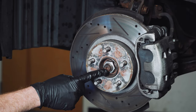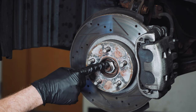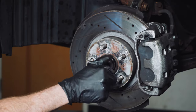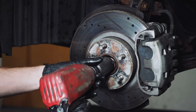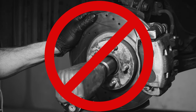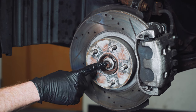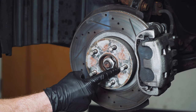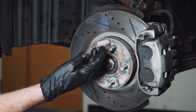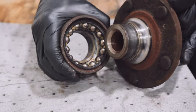By under-torquing this and not peening it in, there's a possibility that the axle will be able to move around a little bit. Worse than that, the axle nut might even back off while you're driving down the road. Another thing you don't want to do is put on your axle nut and use some sort of air impact device. By over-torquing the axle nut, I'm going to cause excessive pressure on the wheel bearing itself. By having pressure internally on that wheel bearing, it's going to cause excessive friction, create heat, and melt out the grease that's on the inside of the bearing. In which case, you're not going to have proper lubricity and you're going to have a wheel bearing failure.